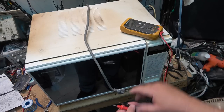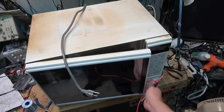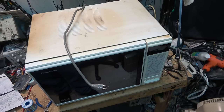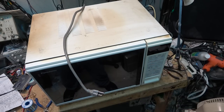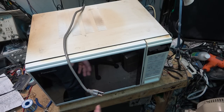This one's tripping the breaker - we have a dead short. More than likely it's one of the switches that's gone bad. These units tend to get pretty filthy inside because they're more of a conventional oven. I've never seen one of these units that's been clean. People bake in them just like a conventional oven, so you're going to have food splattering. You can't really clean these like a conventional oven because of the way the elements are designed - you can't spray oven cleaners on them; it will damage the heating elements, and you can't use anything abrasive.